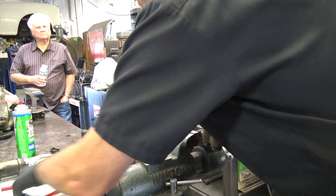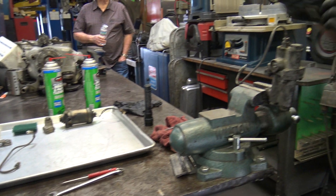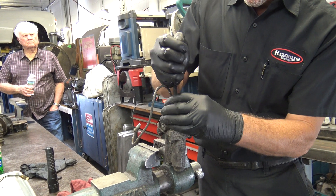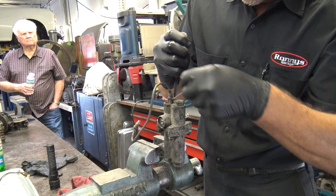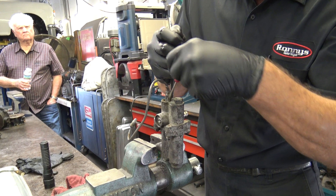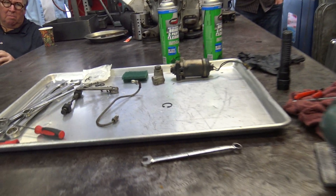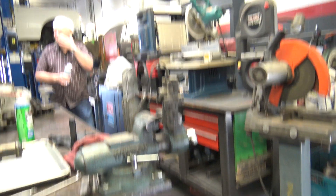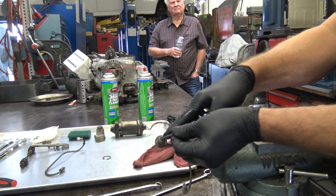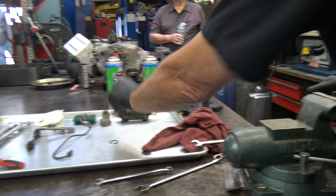What's nice about this is it's hard to mix up because the next one is attached to a housing that has a snap ring in it. So what I'm going to do is take the snap ring out. You can see there's a snap ring there, and then this thing should just turn and pull out. As you can see this line does screw into something, but there's no sense taking that apart — you're just going to pull this off and do that. There's an O-ring in there.